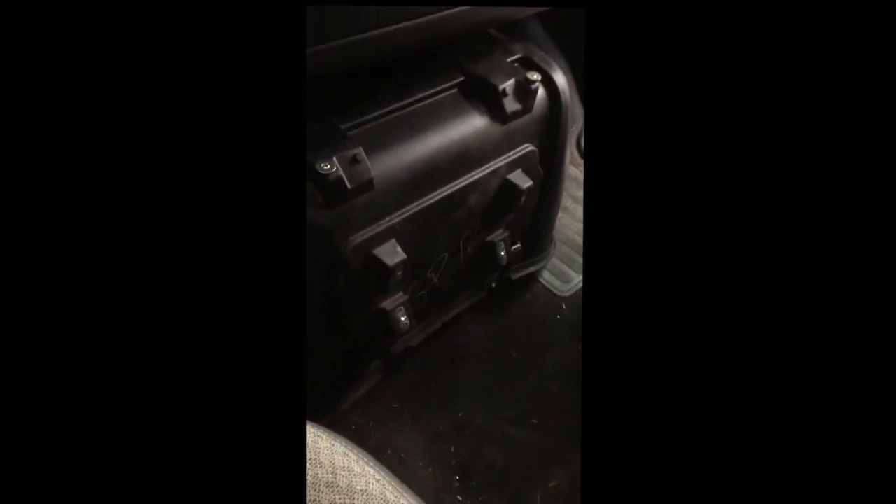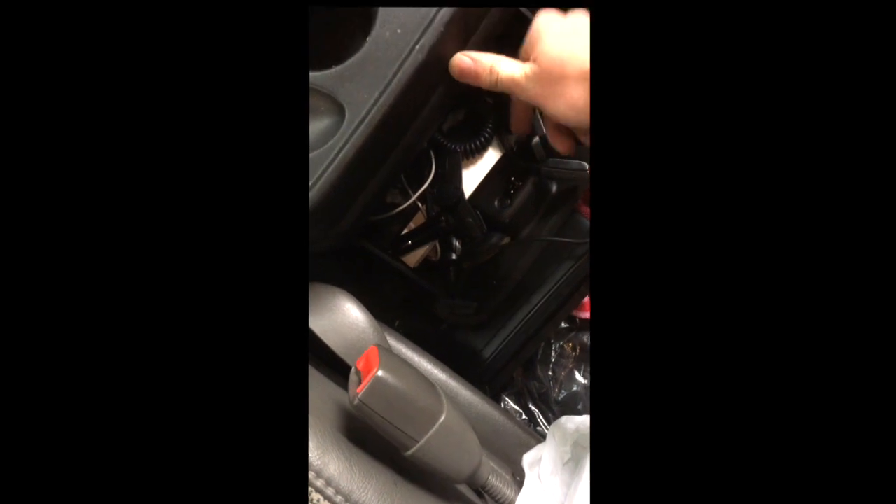What you're going to do is take off the engine cover that is inside the car. The engine cover fits like this — you take it off. There are four screws that are accessed through your center console where there's the dash. You hyperextend this little door opening. When you go to open this compartment in the center console, there's a little rubber piece here. Pull that forward and it lets the compartment out far enough that you can access the screws back there.